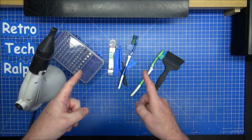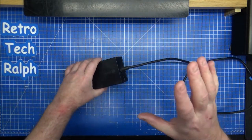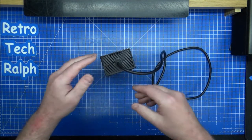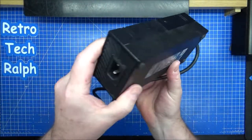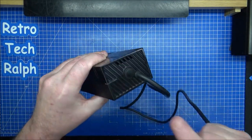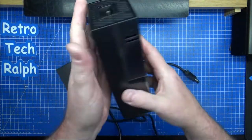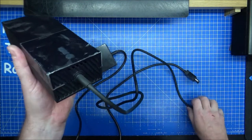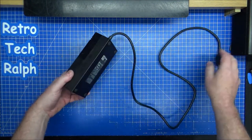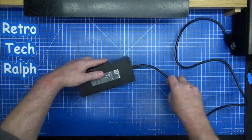Let's get on with the first bit — I need to strip down the power supply and see whether that is the problem. Here's the power supply. I've actually been testing this. The Xbox One S power brick I have: the power light goes orange when it's not plugged into the Xbox, and white when it is. This one stays orange when plugged in. So it's probably the faulty one. The electricity is gone so it's safe to use, though there will be capacitors inside so be careful.